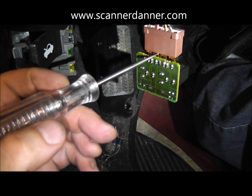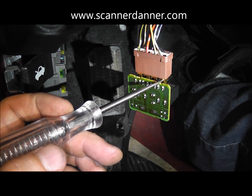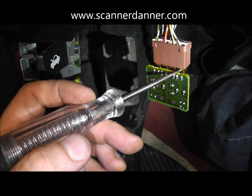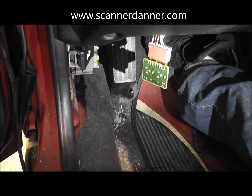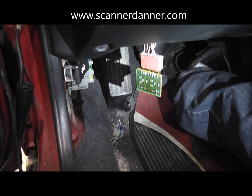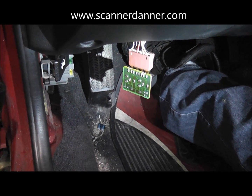The white with green - the test light is not lighting. So we're going after the white with green circuit and the fuse. I know we said these fuses don't fix themselves with an intermittent problem, but is this the first time it happened? Last night it was cranking but wouldn't fire - I gave it a little bit of gas and it fired right up. So as far as we know this is the first time it's been a no-start. Maybe I interpreted that wrong as far as being intermittent - we're going to the fuse next.